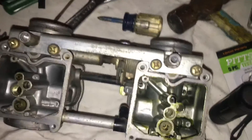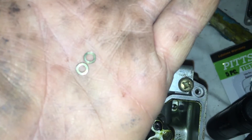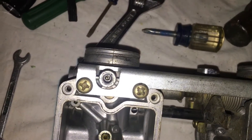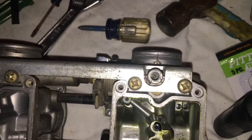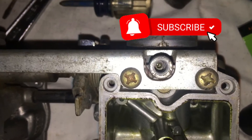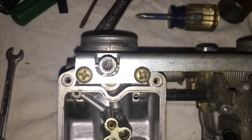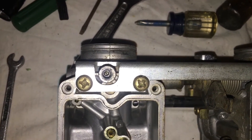Just a quick note: down in these holes, make sure you don't lose the little washers that are seated beyond the spring down in both holes. If you don't know they're down there, they may not come out, but they might fall out at some point. Make sure those washers are safe and not stuck down in there. If they don't come out, fine — but clean out that area anyway. If they do come out, don't lose them, because you'll want to put those back in before you put the spring down, and then before you put the idle adjustment screw back in.